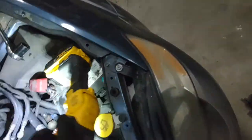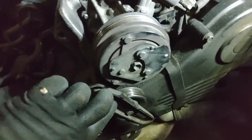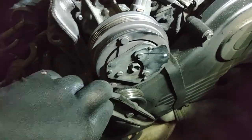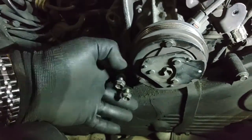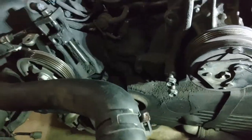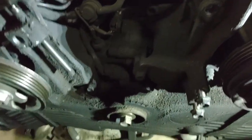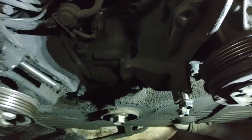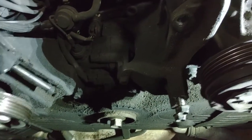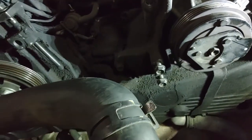To wrap up what this video is meant to cover: there are two 12mm bolts holding the AC belt tensioner in. Undo those, she's out. Put the bolts back in their holes so you remember where they go — great habit for anyone who has trouble tracking hardware. Now that we're opened up, the next step is pulling off the timing cover, setting the engine to top dead center, and doing the timing.